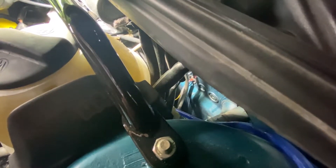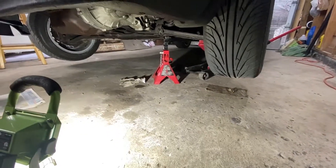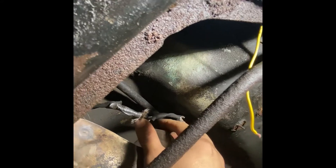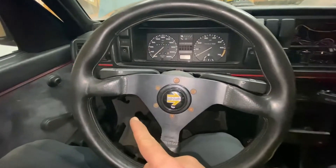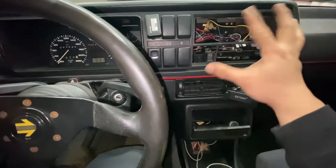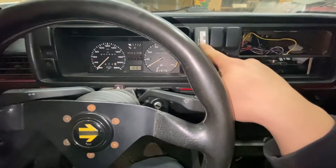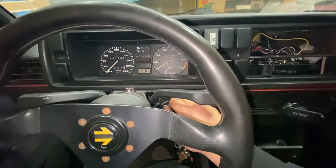From the strut tower you can see the yellow wire coming out of the grommet on the other end. It's vacuum tight to prevent leaks and sealed pretty well. We'll probably cover that wire. Now we jack up the car, make sure you have a jack stand underneath, crawl under, and there's our signal wire. We undo some electrical tape around the O2 sensor and wire it in to that black wire. Power wire is connected, ground is connected, and the signal wire is connected at the bottom of the car. Haven't pushed in this gauge yet — want to make sure everything works first.